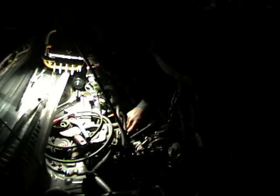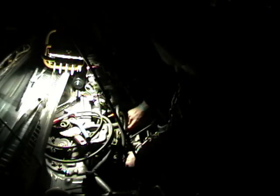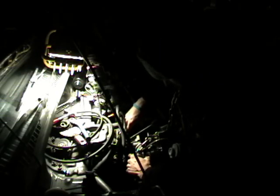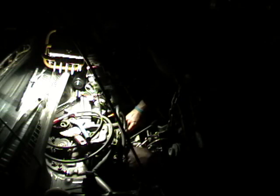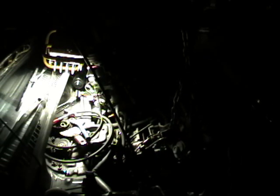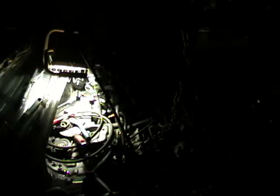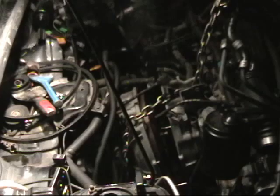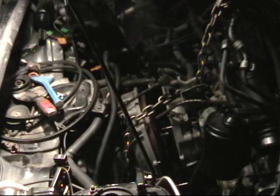All right. Get that torque converter. For it to go all the way, you gotta kind of turn it, but we just wanna make sure it's not stuck to the engine. But the studs, we'll wanna catch on it too as you go up, so we don't want that thing hanging out too far. All right, now we're free. Let me get that torque converter spun back in. There we go, there's our bell housing coming apart.